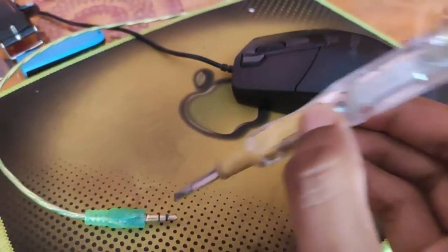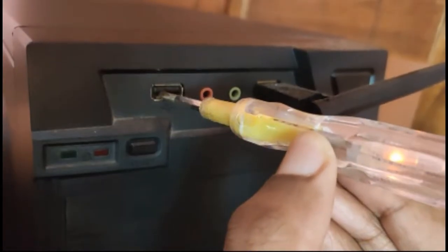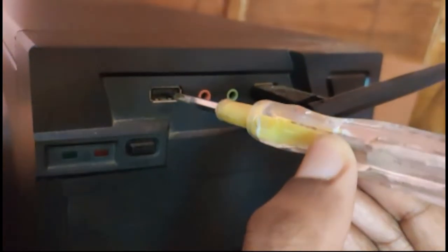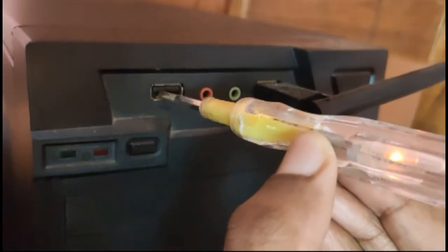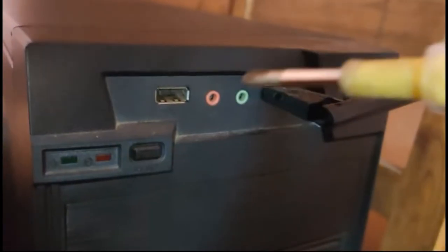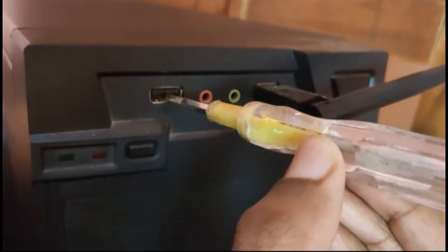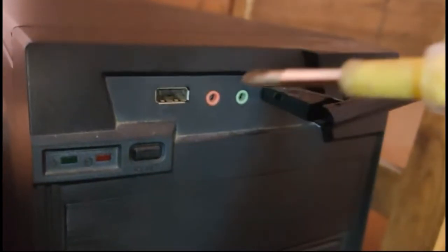To reduce the problem, we have to find out the short which is causing this. Most of the time the motherboard is causing this issue. We should ground at least one motherboard standoff to the PSU. You can put an electrical ring terminal under the standoff and screw that standoff down to the motherboard tray.